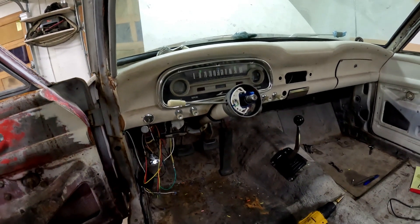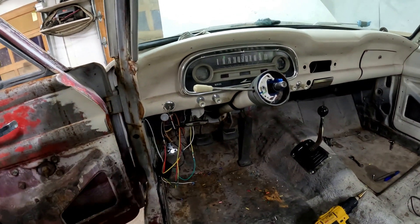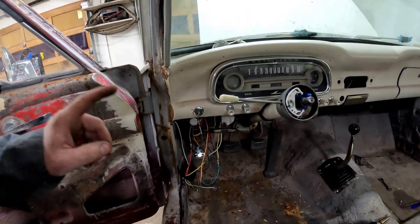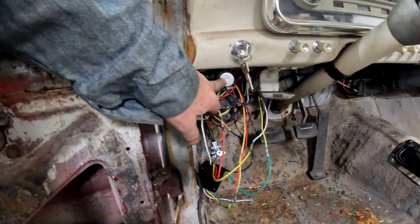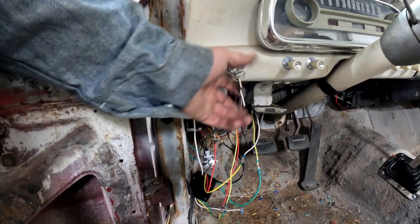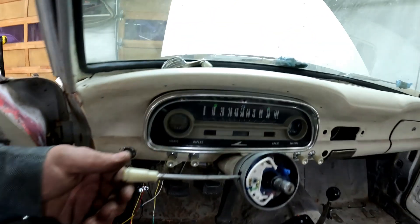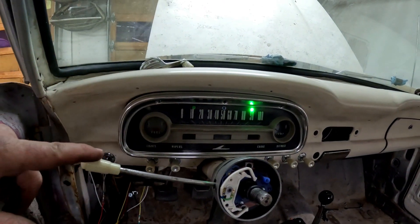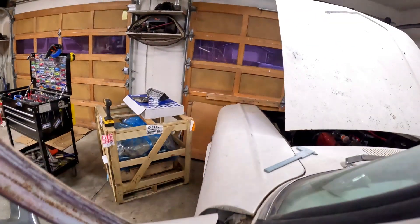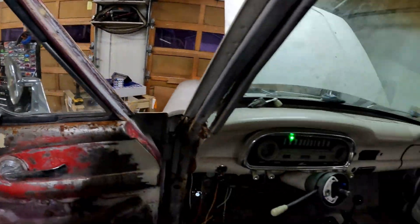Showing wiring work is always the same thing - it's just connecting wires and putting it together. I am still having an issue: this flasher doesn't have enough load to really do anything. The key is on, so when you hit the blinker that's the blink light - it's not blinking. You can see up front maybe - it's really not flashing.